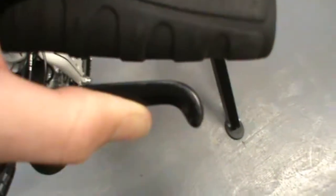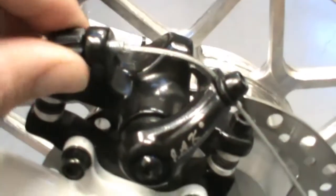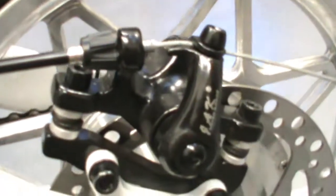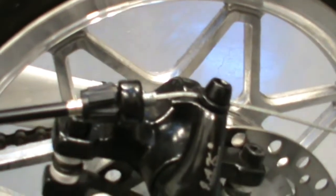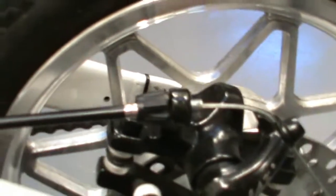After backing off the adjusters, there's no room in there for your fingers — that's way too loose. The adjuster is only two turns out, so it's all the way home. The issue is that if I pull the brake, you can see that the arm is actually going to hit the adjustable screw. That tells me there's just too much free play in the whole system.